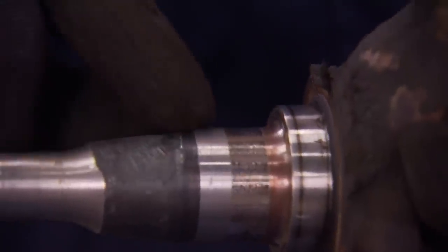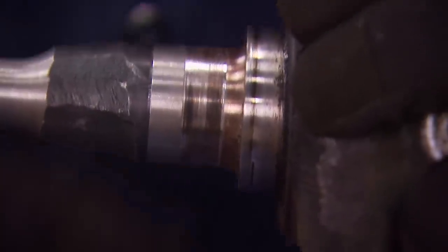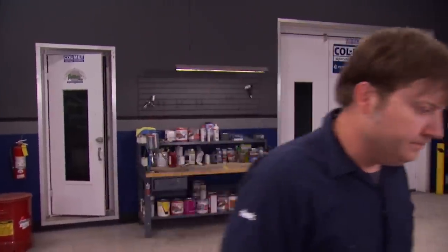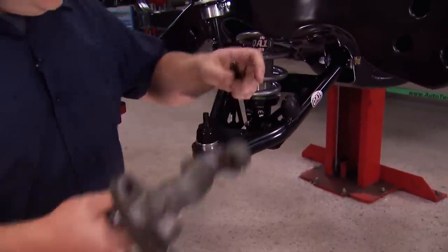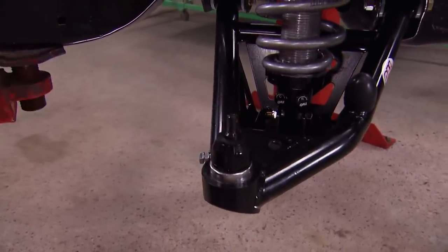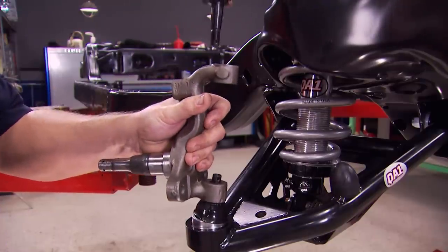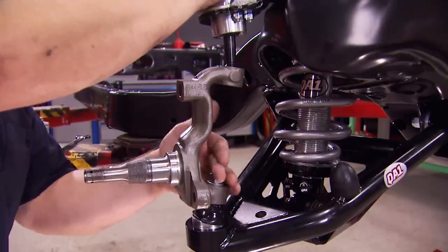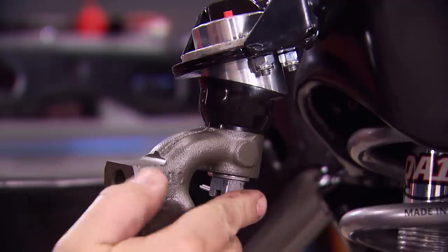The next piece to install is the spindles. Our plan was to reuse the old ones, but after inspecting them we found an issue — you can see where the bearing was, and when you spin it over, the spindle is blued. What happened is that bearing got loose and spun on the stub. If you try to reuse it, that bearing's going to have a roar to it, so you need to swap them for new ones. We just called up Summit Racing and they had exactly what we needed. We sprayed on a coat of Duplicolor cast coat to keep it from rusting. One thing to keep in mind before installing the spindle is to index your ball joints — it makes it a lot easier to get that cotter pin in or out later. These new spindles are just like the originals and slip right onto our ball joints. Starting with the lower, we attach it with the standard castle nut, tightened and secured with a cotter pin. Same goes for the top.